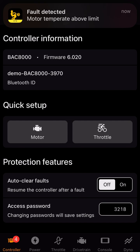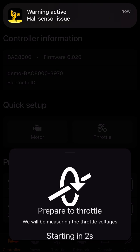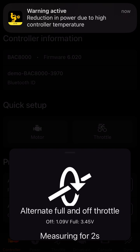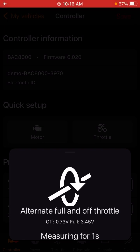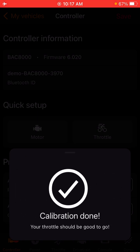The next thing you're going to want to run is the throttle wizard. This is a pretty simple wizard — it's going to have you twist the throttle a couple times. Once it gets to the deadband settings, the lows and highs, it's going to have you test it out. If you have a bike connected, it should read 0 to 100 — that's what you're going for. If it reads anything less or more than 100, you're going to want to rerun the calibration wizard or check the connections of your bike. Once everything looks good, just hit looks good.